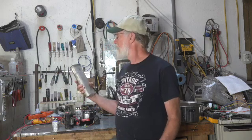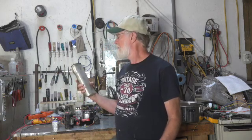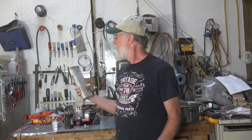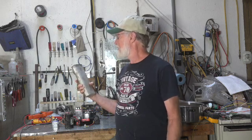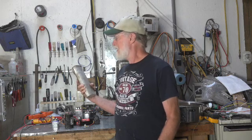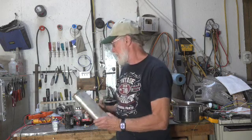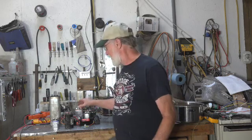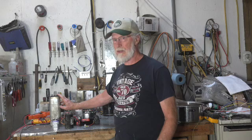Here's another cap — 40 microfarad and 5 microfarad dual cap. Probably made in the late 70s or early 80s. Doesn't have any PCBs in it. PCBs are kind of a big deal on these caps. When I first got in the industry in 1977, they were just getting rid of PCBs, and we were trying to figure out what they were going to use. We did not have failures in these run caps. Caps were something we just really didn't worry about.